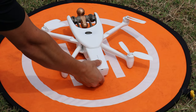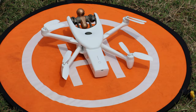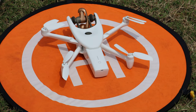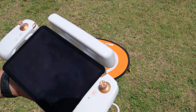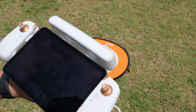Power on the Anafi AI by holding the power button for 5 seconds. After powering on, you'll hear the Anafi AI's 4 motors beep. Then the aircraft will complete a gimbal calibration to ensure the camera is ready for flight. Then power on the SkyController 4 by holding the power button for 4 seconds. The system will be connected when the SkyController is no longer blinking.